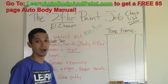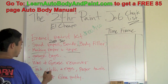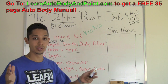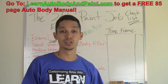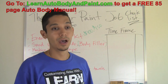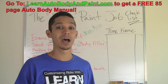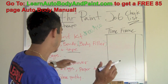Wax and grease remover to wipe down and clean your car before you're ready to paint. You'll also need tack cloths, rags, and paper towels — paper towels to wipe down the wax and grease remover, and a tack cloth at the very end before you start painting. Go over the whole thing with a tack cloth because you want it as clean as possible. You're not going to be tacking between coats because the paint gets sticky — with base coat you tack between coats, but not on the clear coat stage. So let's stick with enamels.